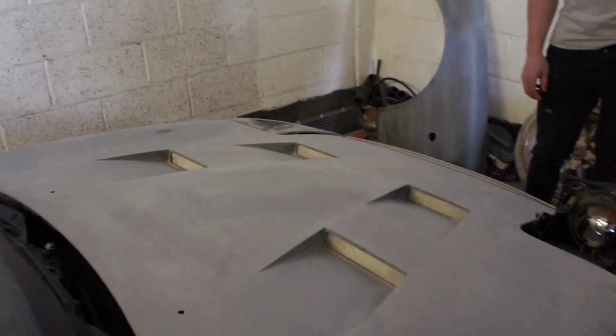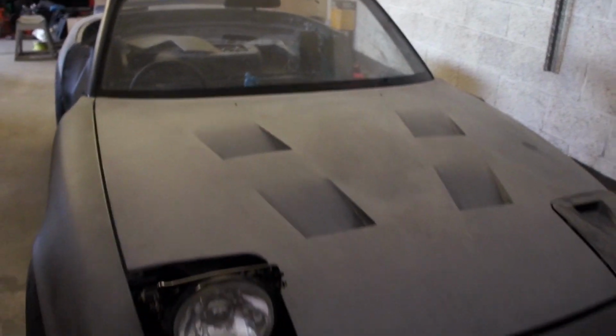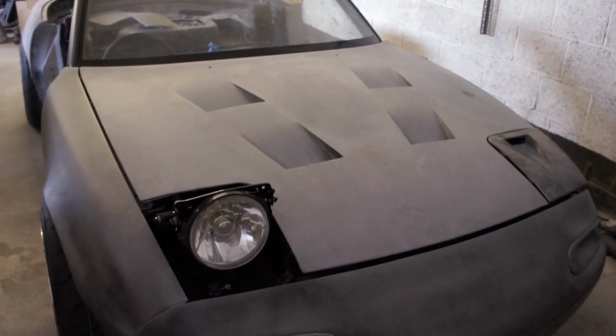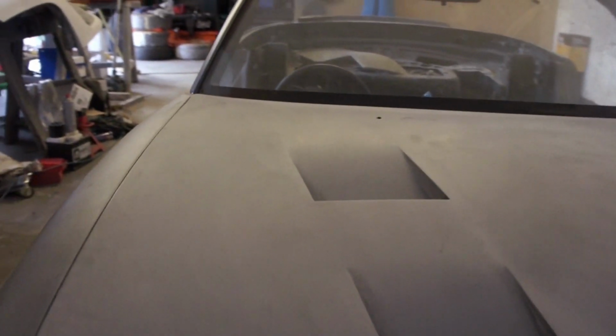So yeah, the bonnet I did from scratch. It's aluminium, so it was a bit more difficult than just cutting some steel out and welding it, so I pretty much had one shot at cutting and sorting it out. I just actually thought you bought a new bonnet when I came in. I thought you bought one like this purposely. Yeah, I pretty much just spent a few hours taping it up, making sure all the measurements were right, and then used some steel guides taped down to it to guide the angle grinder, and I just took my time and was dead careful with it.